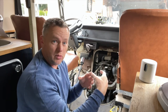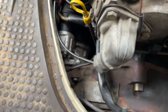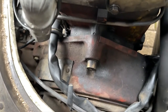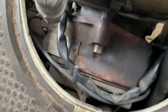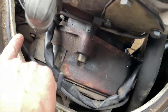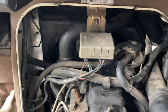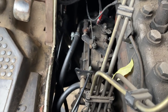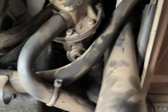The starter motor is on the side and that's got to come out - I've labeled the wiring on it. The starter motor is an awkward little monkey. The hardest bolts - you have to put a long extension from down the side of the gearbox from underneath to get onto those. The starter motor itself just has a few wires and a bracket at the bottom. We'll move away some of the ancillaries - the glow plug relay, a fuel pipe that needs disconnecting, the starter motor wires, the alternator, and the air pipe. The alternator just needs to be swung back to give a little more room.